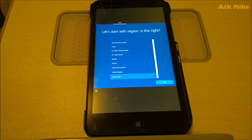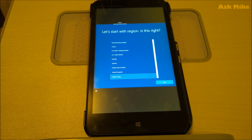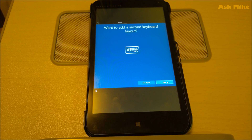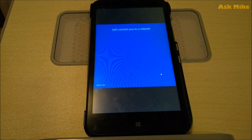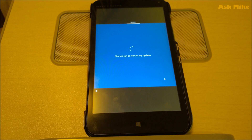Once you have the startup completed, you can't do anything to it because the touchscreen driver and everything is not there yet. You'll still need to plug in your OTG mouse and go through the driver installation — click yes for this. Then continue on with the setup. For the keyboard, USB keyboard — yes. Skip for now. Go past the setup screen. There's a network that you need to connect to, so connect to a network. Once connected, click next to check for updates.